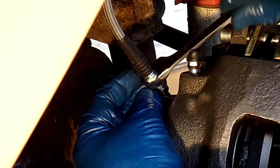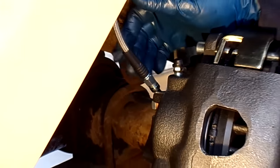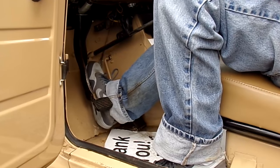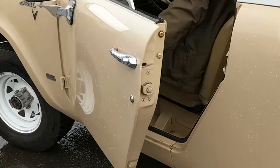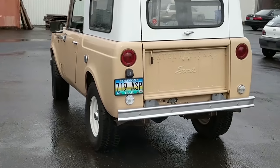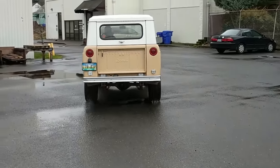In the upper right-hand frame you'll see a silver nut — that silver nut is for bleeding, and when you install your caliper, always make sure that it's in the up position. Here we're doing some bleeding of the brakes, which is what you're going to have to do to get it on the road. Never ever test your brakes in traffic — always find a place like a parking lot where you have lots of space to brake and come to a stop. Here at Scout Parts we make lots of kits; this particular kit is SP18307. We've enjoyed making them for you, and have a great drive.